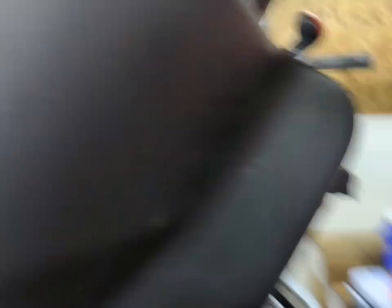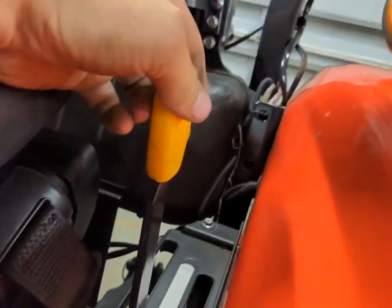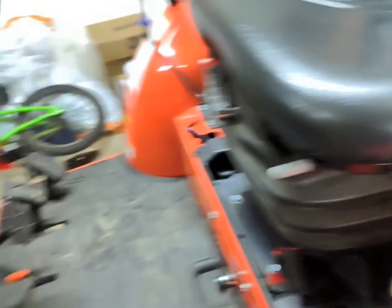So after doing some feeling around, there is a ton of room behind this panel. This metal brace for the steering column does kind of come up by this seam here, but then once you get past that, there's also a ton of room. We also have all the electrical and the relays are right here already for the machine. So I'm thinking if I just put it up in here, this is probably going to be the easiest spot. I'm just nervous about it being back further in the operator station near the PTO controls, so I think I'm going to give this a shot.